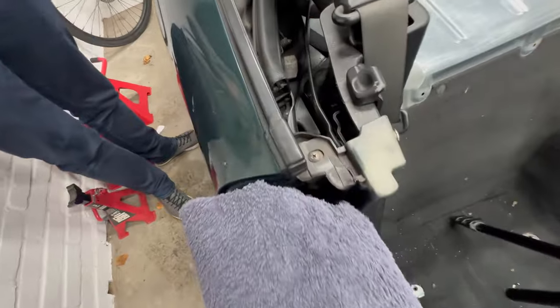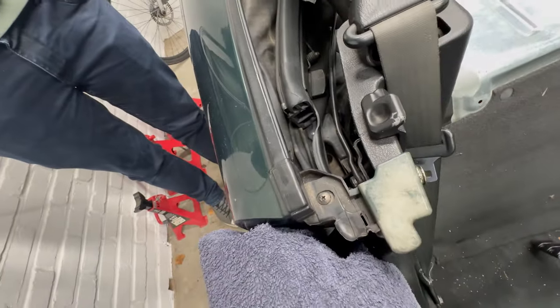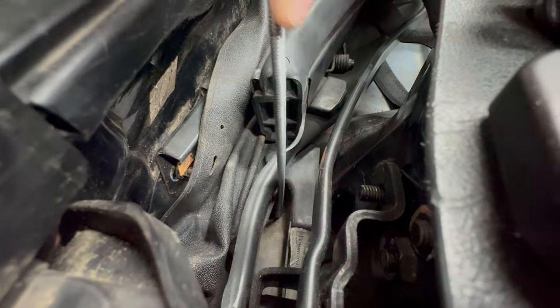In the meantime, let's make sure that any water that does enter the rain rail can exit the car properly. For this purpose, the Miata has two drain holes, one on either side, right behind the doors. They should be reachable with a properly mounted top as well, but the current state of it being loosely installed makes it a bit easier.